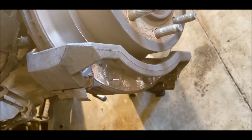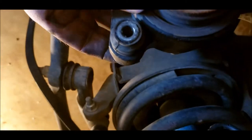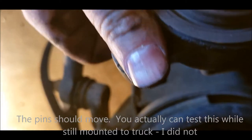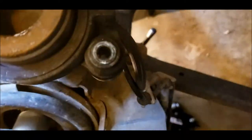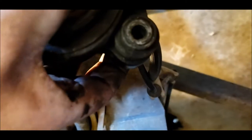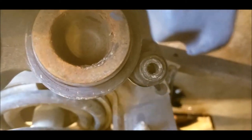There's really no way to test if your glide pins are bad until you're at this point, but at this point you can test. For this one I'm just going to push on the backside - you can see it's moving back and forth without too much pressure. That's what we want, so this one is good. For this other one I'm pushing as hard as I can and that pin is not moving at all, so this one is bad, this one is good. Going to replace them both because I'm not doing this again.